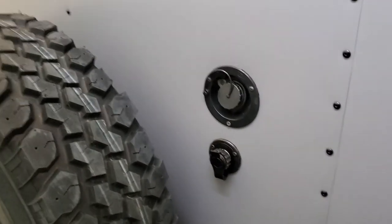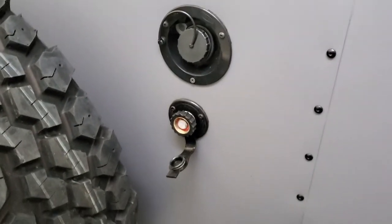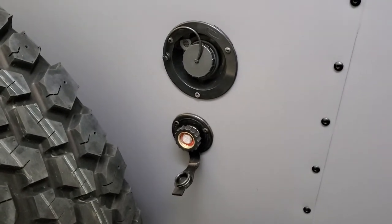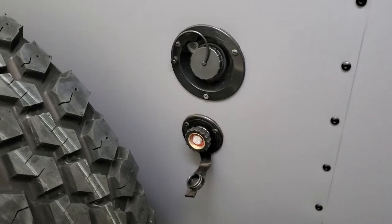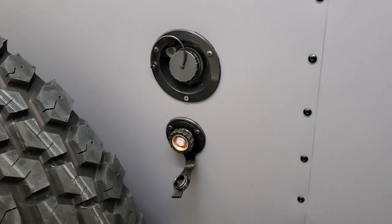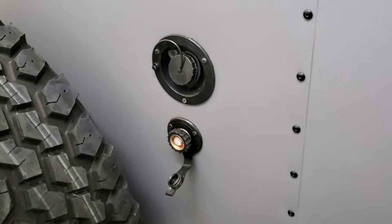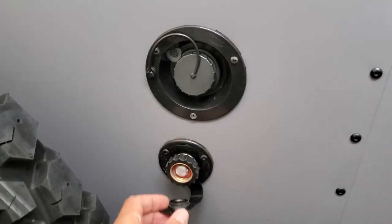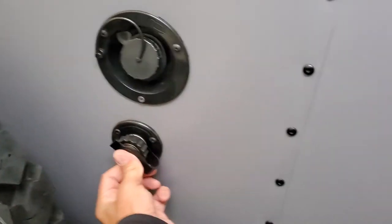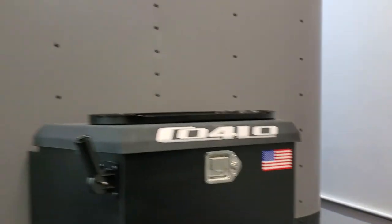Over here on this side there are a couple of inlets — one for fresh water fill and one for city water. If you're camping somewhere with water hookups, you can just plug your water in and it will bypass the water pump and use the outside source directly. A third port will be added that gives you outside water, so you can use the water from inside the trailer pressurized by the pump and run it to a faucet outside — for spraying off dirt bikes, mountain bikes, kayaks, or taking an outdoor shower. Eventually I may add a hot water heater; the plumbing is already in place inside the trailer, I just haven't added that feature yet.